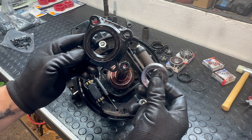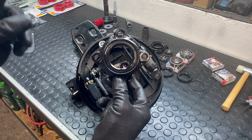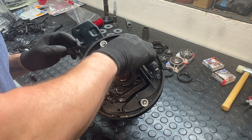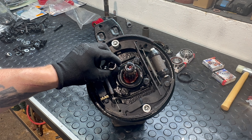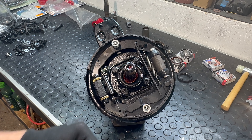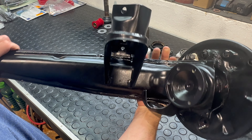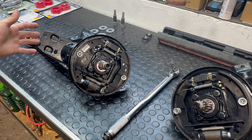We have only two parts left to install — the cover. But there is one thing with this cover: it has two divots on the sides and they have to face downwards. This is the bottom of the diagonal arm, so they have to go that way. New bolts — I love it. We have a problem here because I have to torque this down to 43 foot-pounds and my socket doesn't fit anymore, so I bought the wrong bolts. Originally they had smaller heads, so I think I will have to replace them in the future. The last part — we got it. This is how it all looks, and it's super heavy.